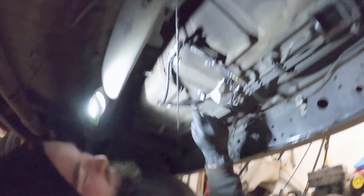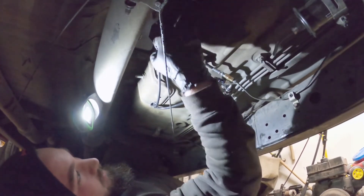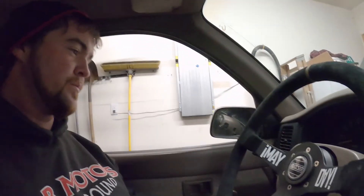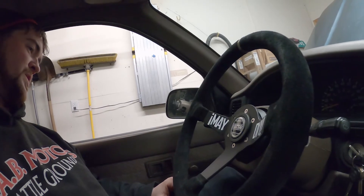Now we have to get to the fun part. Just to be mindful, this says 'out' - out to the rear. This one says 'in' - in from the master cylinder. So the last step in the process is to bleed it out. Bleeding it is a normal thing - you bleed it just like normal. Maybe give this a couple of pumps towards the end just to make sure nothing's stuck in it. The pedal's definitely not hard - lots of air in there.